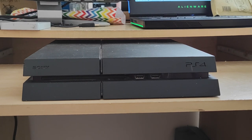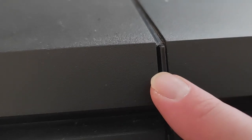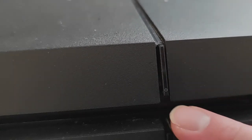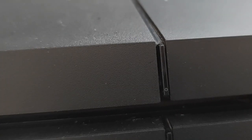So how do you know which one you've got to make sure you're using the right technique to get the base off? The first and easiest way is to look at the front of the unit at the power and eject buttons. On the earlier consoles these were a capacitive type, but this is definitely a 1200 series machine. You'll notice the button actually physically clicks in — you can click it. So when you press it, it physically clicks, and the same with the eject button — you can physically click that in too.